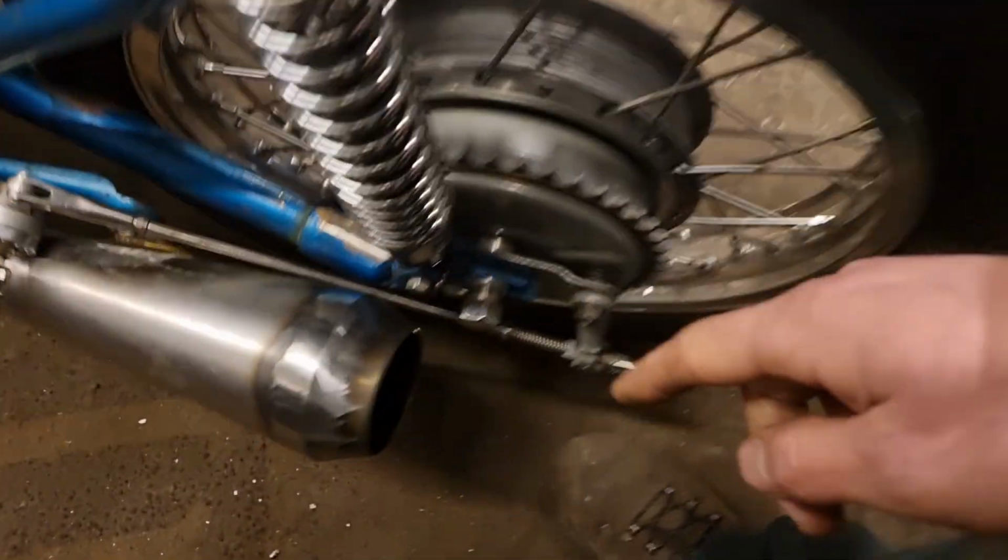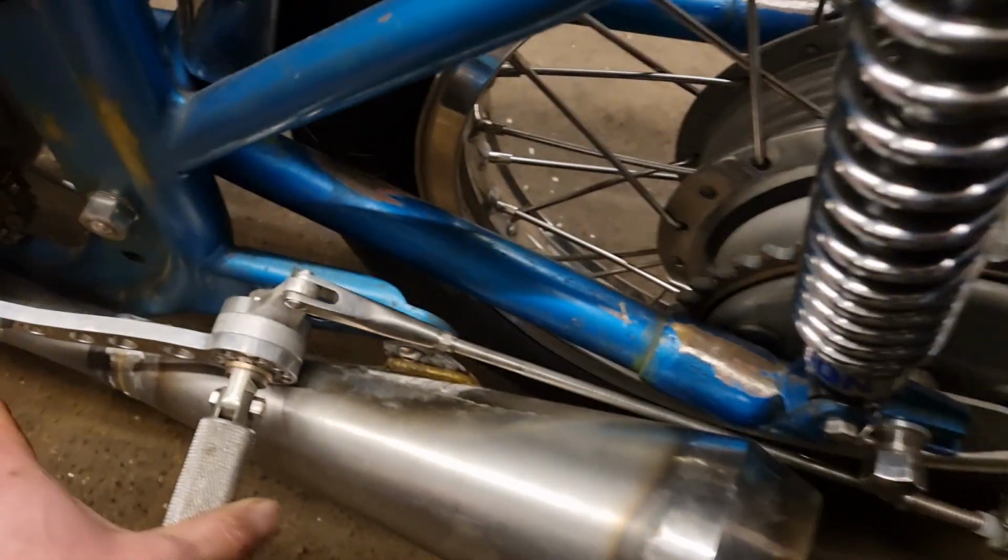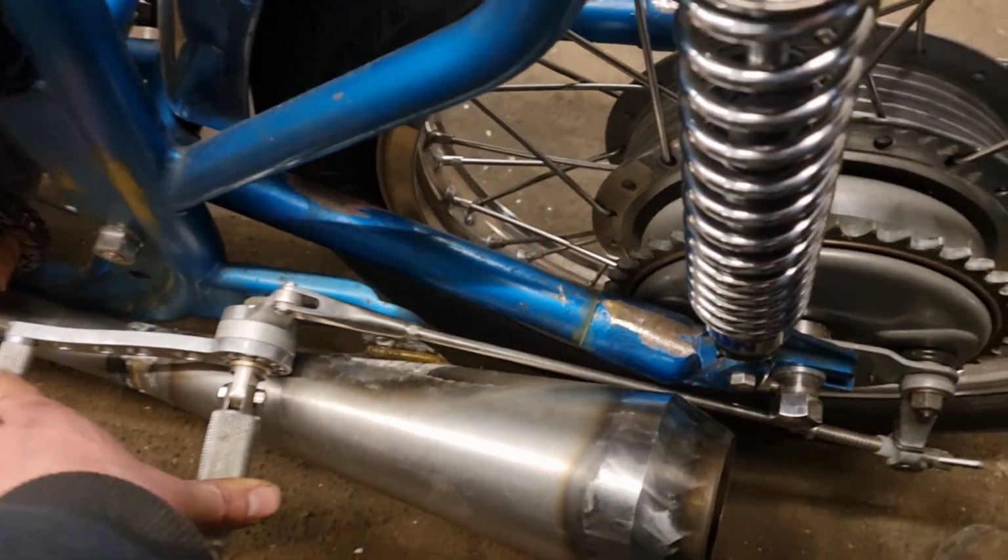Oh, one last thing, I put a washer in here. It's a little bit thicker down back of there. You might not be able to see that again. Everything's in where there's a thicker washer there. And now I've got, you might not be able to see that either, between there and there's a little tiny gap there, isn't there? So when you press the brake rod down now, it's not touching that. And that's the stuff you want.